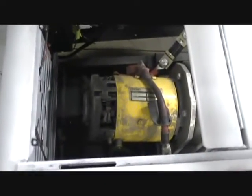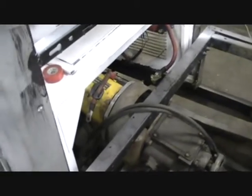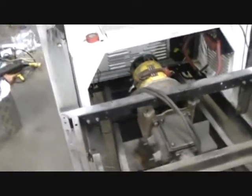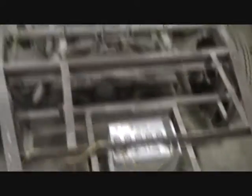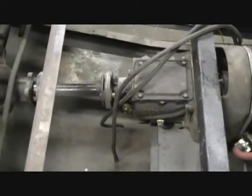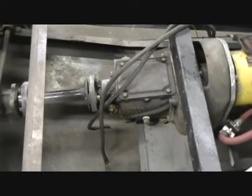Now it is a 7-inch motor — I know you guys in the EV world are going to cry about that a little bit. But it's worth a shot; I got barely nothing into that motor. I got it in trade for a car engine, and it's a good running motor. I cleaned up the armature in a previous video. And I know some of you EV guys said to leave the armature alone — well, too late. But that motor is going to drive it just fine. I've ridden it around a little bit in the yard here on 12 volts, just running it across that battery, in fact. The speedometer is going to be one of those bicycle-type ones. I thought of going with the mechanical speedometer, but my front hub does not have the pickup for it, nor is it made for it. This one was designed to have it on the back side of the transmission — I don't have the cable, I don't have the speedo, and it would cost hundreds of dollars to get both of those parts. The bicycle speedometer is about $10 direct from Hong Kong — takes a month to get here, but it'll be fine.